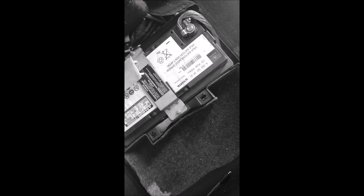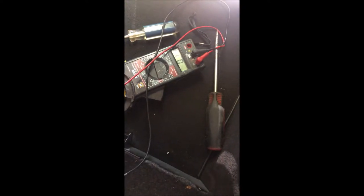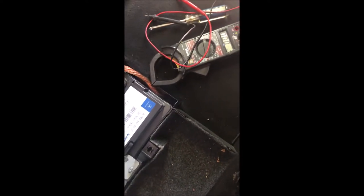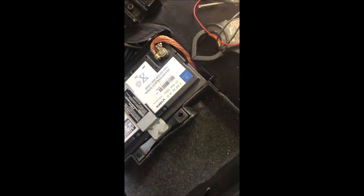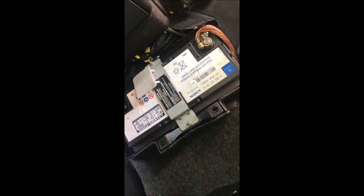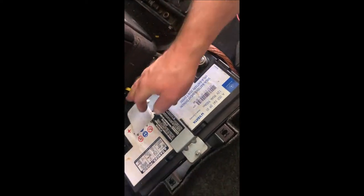I don't see a date on it — is there a date code on it? I don't know. I'll pull off the positive cover and get a reading directly from the battery. Negative and positive — what are you showing? 11 volts. So the battery's only got 11 volts in it. Most likely it is the alternator not charging it past that, but we don't know that 100% yet. I'm not going to go replacing parts without knowing for sure.